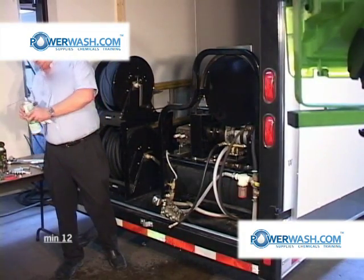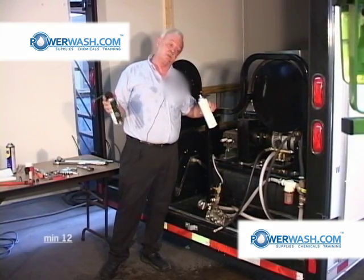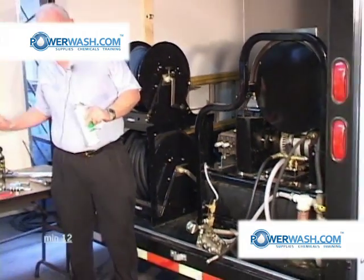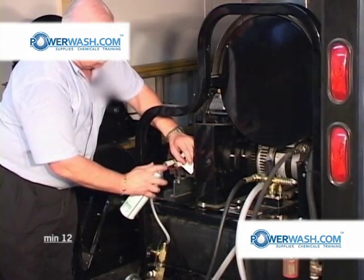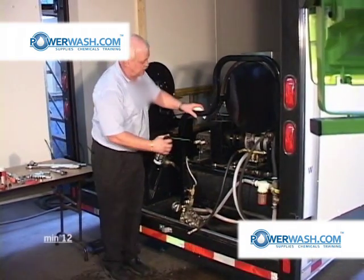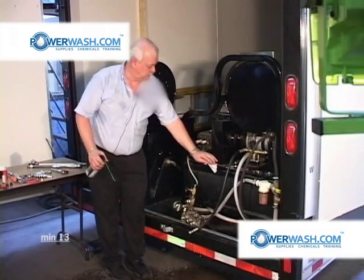Next, you can use solvent — this is carburetor cleaner — and a can of canned air like you might use on your computer. If you happen to have a compressor with an air hose handy, that's even better. I'm going to blow all that loose stuff out of there. You see how all that blew out? Now just to be on the safe side, I'm going to put a little carburetor cleaner in there. Note that I'm going to cover this hole partially with a cloth so it doesn't splatter back in my face. Then once again I'm going to take the air, being careful to protect my face. Then you allow a moment for it to dry.